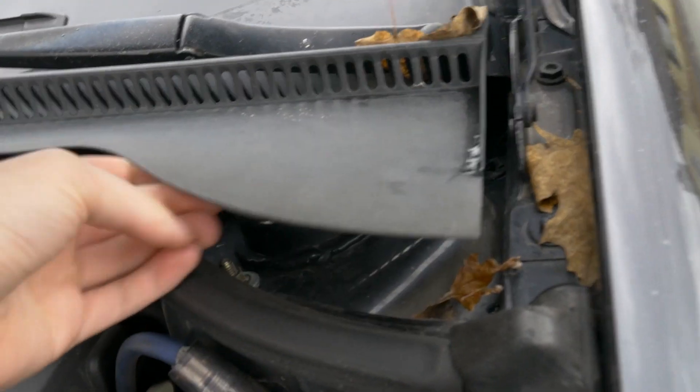So I opened the hood, lifted the rain cover, and there's no adjustment knob. And I didn't have my spanner wrenches either to adjust the coilovers. I had to call up the shop and say, where are the rest of my parts? Because they basically robbed me of my suspension setup — they kept the spanner wrenches for adjusting the height and the adjustment knobs for the dampening. I had to go back the next day to pick those up, and then I could finally soften the suspension.